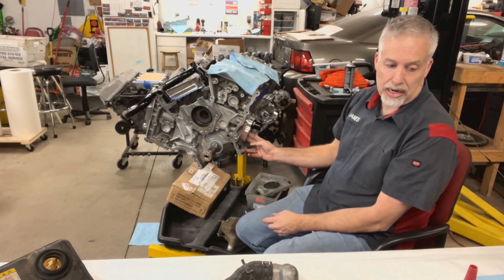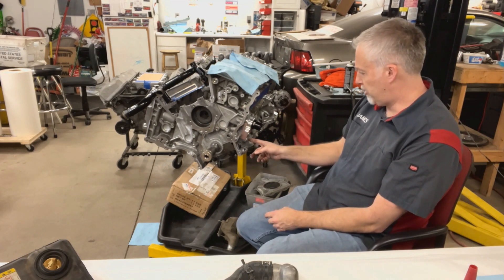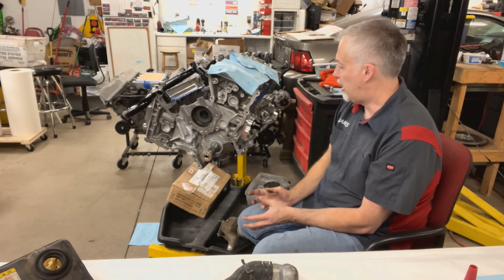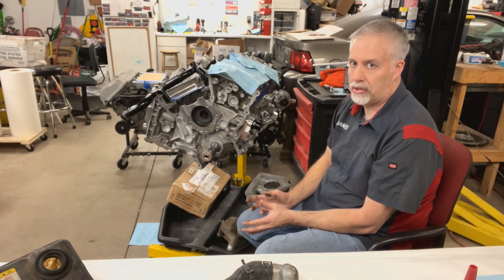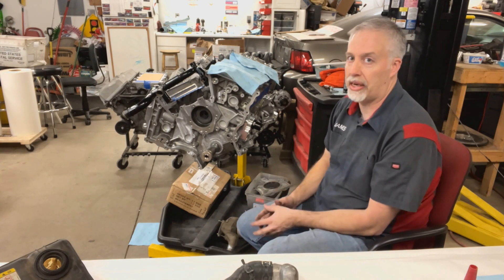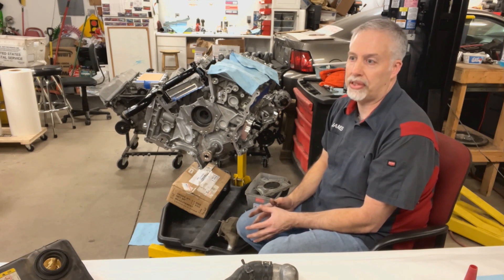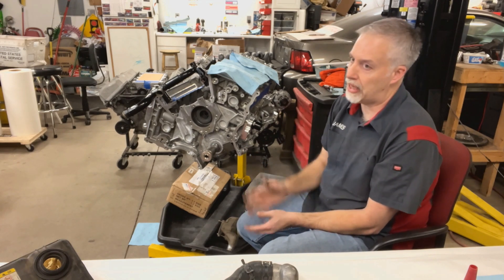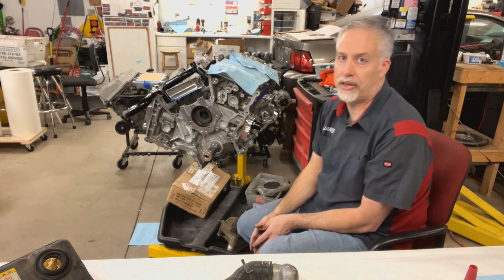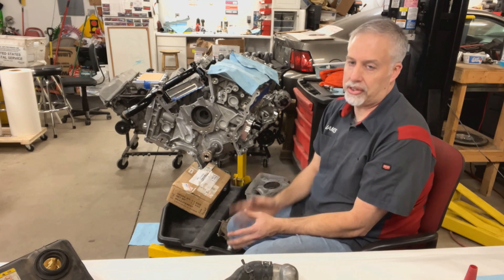This has two dash-10 O-ring ports and it's labeled — one goes in the engine, one comes out. Very simple. If you run an external oil cooler, you have to run an oil thermostat. Oil can over-cool and it will not function properly — you're going to have water in it, you may leave gas in it. Bring it up to temp; that's where it's engineered to function. You have to make sure you've got an oil thermostat if you're going to run an external oil cooler.